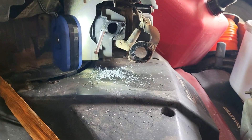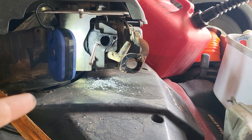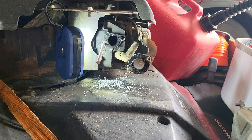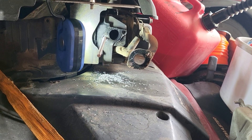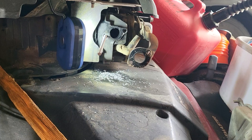If you're going to fix a Toro Time Master muffler, that's how you do it — you just have to be careful and patient. This is the kind of thread insert that you use a flathead screwdriver to put in, as opposed to a helicoil. So it's thicker, it's cheaper, it's easier to install, and it works just fine in the head of this Toro Time Master.